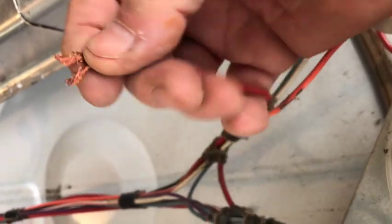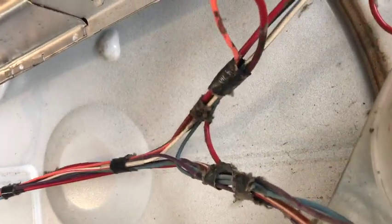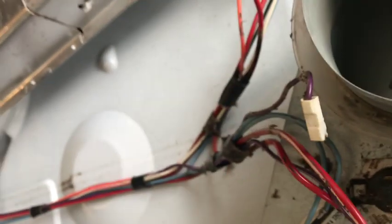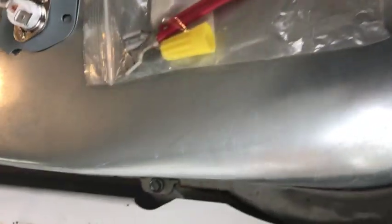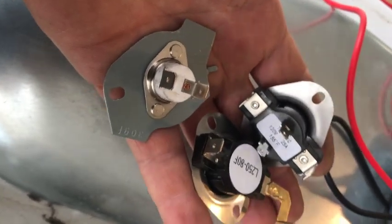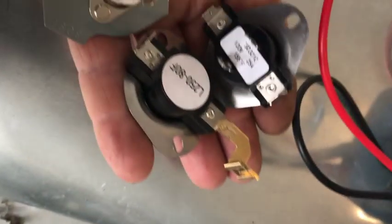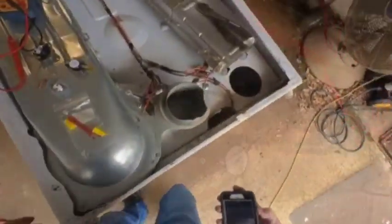So I knew there was going to be some major repairs on the inside. The first thing I was going to have to do was splice the element wire back together using jumper wires that I get from McCormick, because the spade plugs on an element are bigger than normal. I also had to use a smaller spade plug on the cycling thermostat because it uses a normal spade plug. And I got the thermal cutoff kit. I replaced everything in there except for that little white thermal fuse, but nothing was wrong with it, so I left it alone.